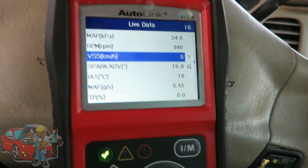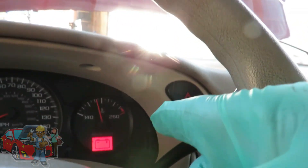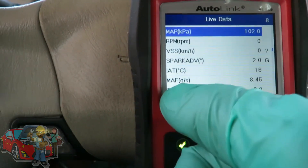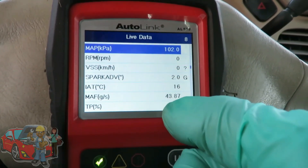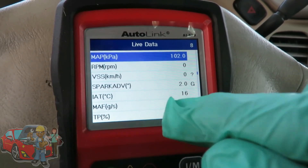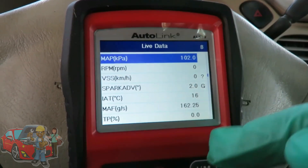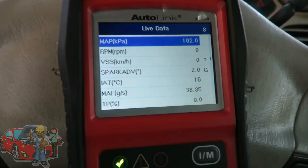Let's get this car warmed up and we'll be right back. The car got warmed up and it shut off. Right now our mass airflow sensor — key is on, engine off. You see the numbers how they're jumping like that? That is not good at all. It should be a minimum of 2, jump up to maybe 30 or 40, drop back down to 2. You saw that 164? That is a bad signal right there.